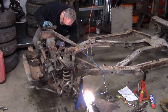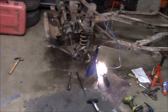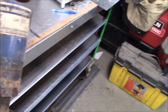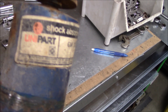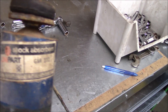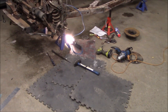Progress is slow but we're making it. These shocks can be a bit of a bear to get out because the bottom H-brackets rust to the studs at the bottom of the spring pan. We got it out — I think this shock might be original. It's a Unipart GSA 272 with the little British Leyland logo. Don't normally see those stickers, so I thought I'd take a quick video of that.